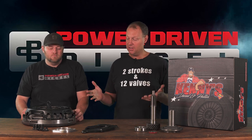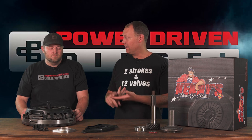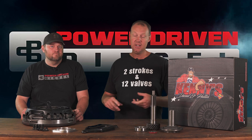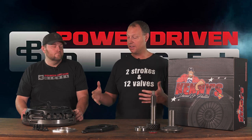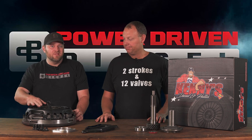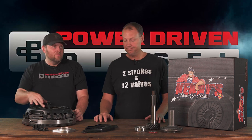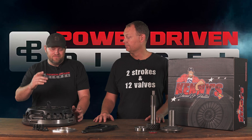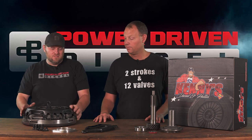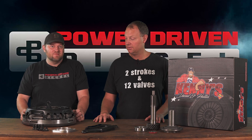This is a dual disc, full organic clutch — really meant for the towing crowd. It has really smooth engagement, so if you're backing your trailer up a hill it's not going to grab and shimmy on you. It's a lighter pressure plate, not a big raised 3,800-pound one that kills you. You don't technically need upgraded hydraulics or anything for it. It's just a nice, smooth clutch.